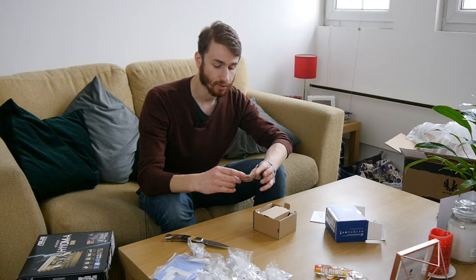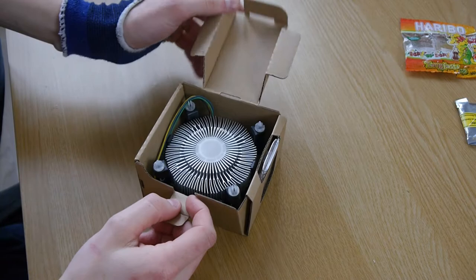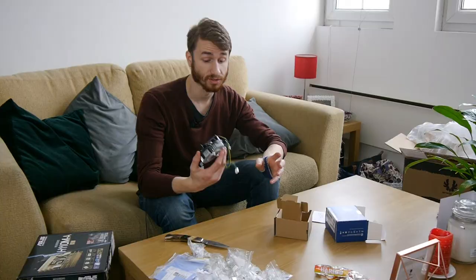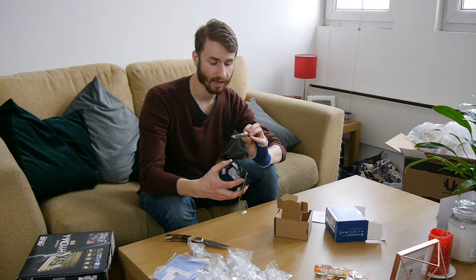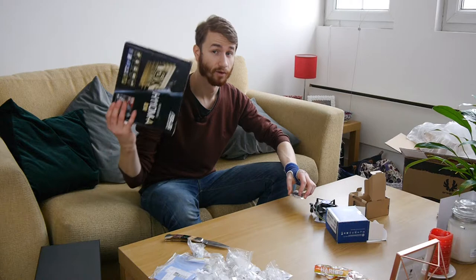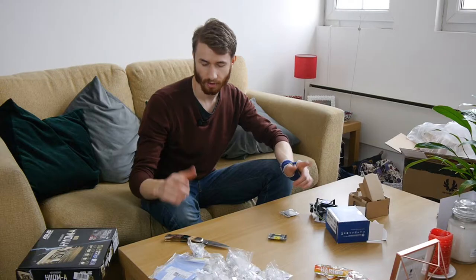With the Kaby Lake architecture, these run at about 3.5 GHz and work really well for budget gaming. They come with a heatsink — it's not a nice heatsink, it's pretty small and pretty crappy, but it works more than good enough. You're not going to have any trouble cooling the Pentium with this cooler. One thing I'm worried about is the BIOS — if it isn't up to date on that motherboard, this just isn't going to boot. We also have a motherboard to check with our old i5. Let's get cracking and test these parts.